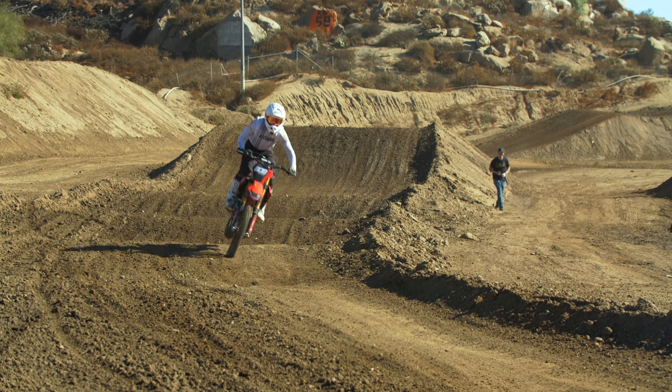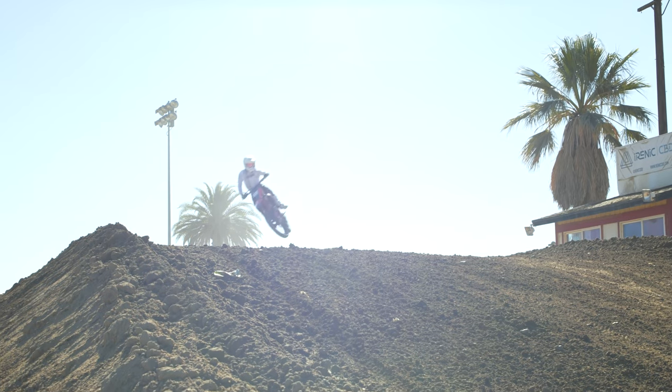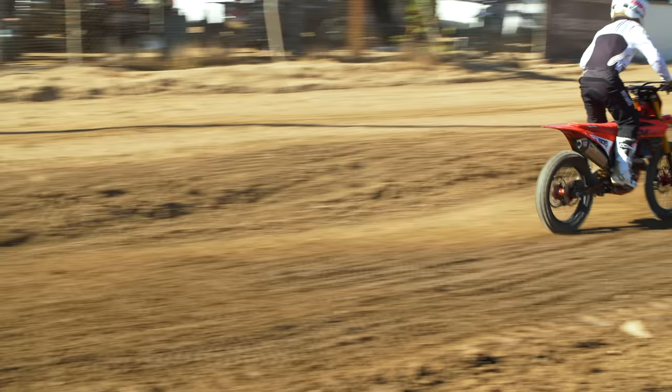We did set the sag, and believe it or not, we settled at 84 millimeters of sag in the rear. That's just as much as we can get out of it because the spring rate was so stiff. You really couldn't tell, except for on a couple of the corner exits. The Ohlins stuff is just so plush.